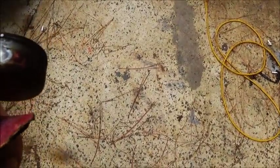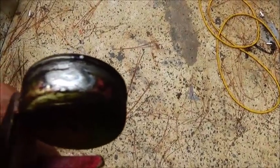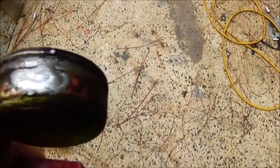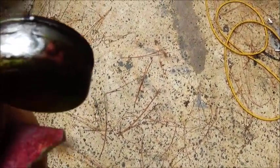Okay, putting the carburetor back together, and of course I came to a spot on the bottom that had a hole in it, where it sits down in that gummy stuff. This side seems to be okay. I'll clean it up a little better and make sure. But you know, the solder is a little heavier than the brass or the copper. So what we'll do is sand some of it off, grind some, or file some of it off to make sure it lightens it up.